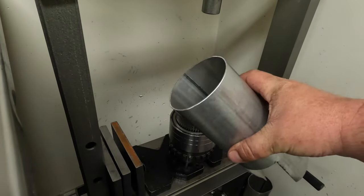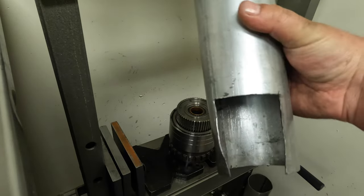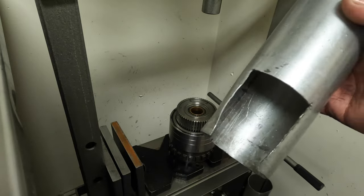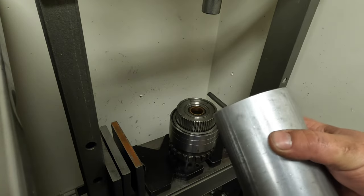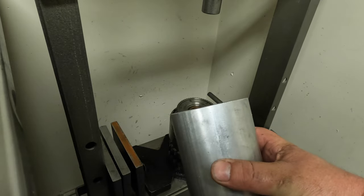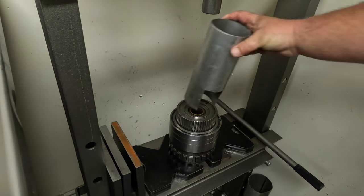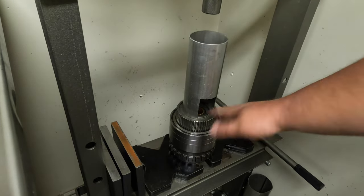I have another fancy homemade tool — a three-and-a-half-inch piece of exhaust piping with a nice square window cut in it. When making this yourself, you want to make sure that you cut the top as close to square as you can and have the bottom as squared up as possible. Because when you press this overdrive section apart, we're actually pressing a planetary spline apart, and if this isn't going in and out nice and square, it'll actually tear it up. So this is a tool you can still easily make yourself — just be sure it's as square a cut as possible.